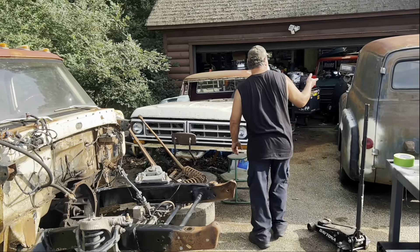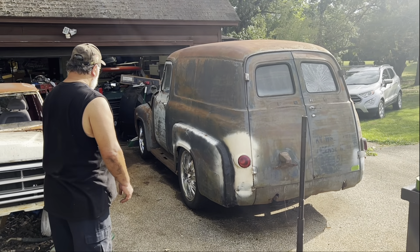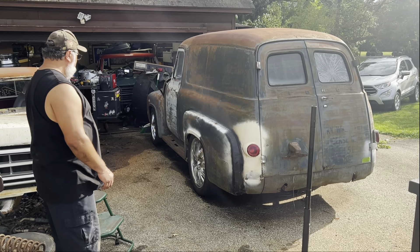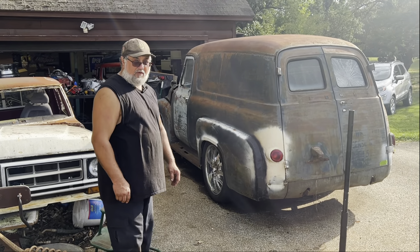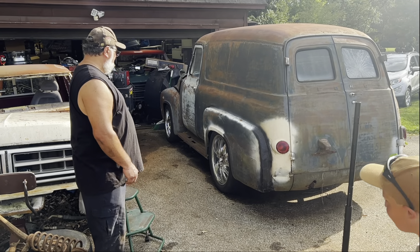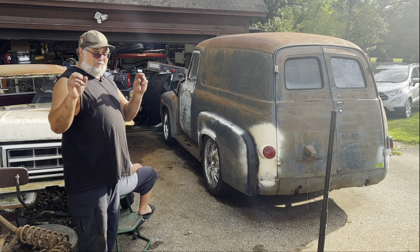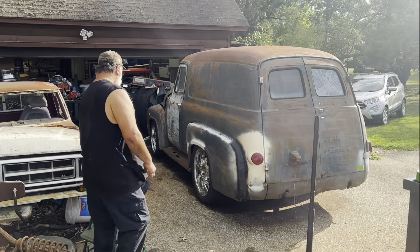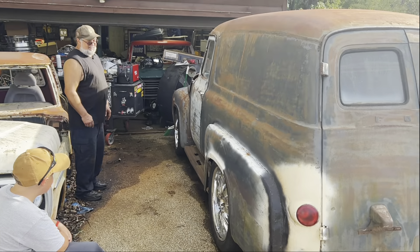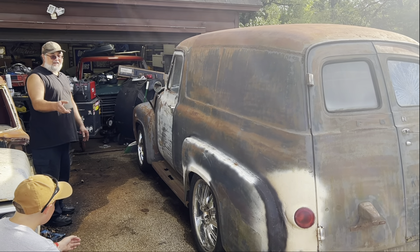And then this is my '55 panel truck. It's Crown Vic'd also — John says I Crown Vic everything, which I do. I widened the back fender because I put a Durango rear end in — I like the big disc brakes it had. It's an '04 Durango and '04 Crown Vic, so the bolt pattern is actually bigger on the Durango. I bought a bigger set of wheels — I got 22s on the back and 20s on the front, just like my maroon truck.